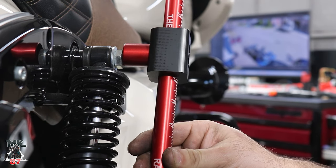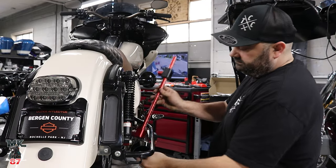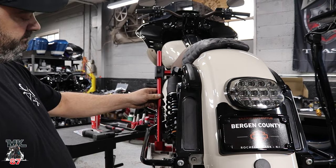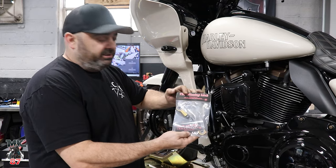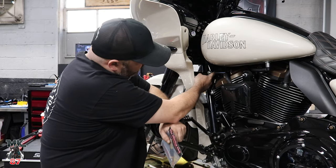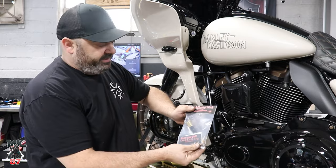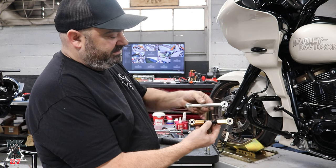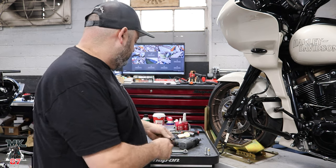You can see I can't get this to go on — it's way off. This is telling me his back tire and his engine are misaligned. So we're going to install the missing link now. This is the adjustable engine mount that takes the place of the stock solid one that Harley Davidson installs from the factory. Here's the missing link and here's the stock link from Harley. We're going to install this now and then start the adjustment.